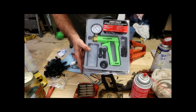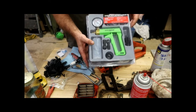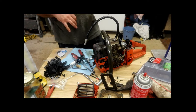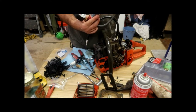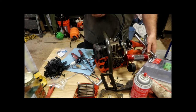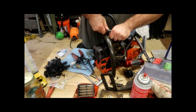You can use a kit like this — this will only do vacuum. I've gone through quite a few of these kits, different brands, some pretty decent brands, and they didn't last very long. So I resorted to buying just the cheapest one I could find for vacuum. And then this is a radiator pressure tester — I cut the end off of it for the cap; it's just an old style off the Mac tools truck. It works for putting pressure in. We're only putting six pounds of pressure in. So I just take the hose that's on there and the compression tester hose, squeeze those two together — good tight fit.